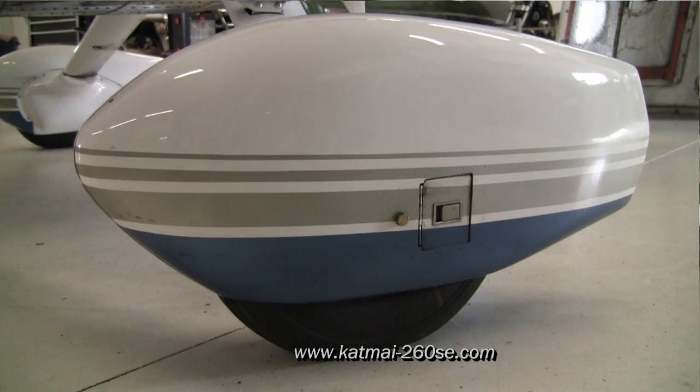The other type of landing gear we have is on our 260 SEs or Katmai aircraft that have the Ferret landing gear. If you've got the standard tires with the speed pants, you really want to keep the tire pressure to 50 psi. And of the airplanes when they come back occasionally for service work, that's probably the one thing I see that's just a little bit off.